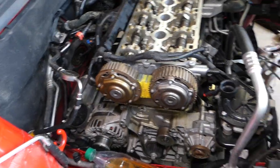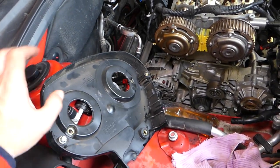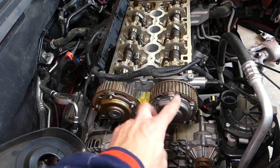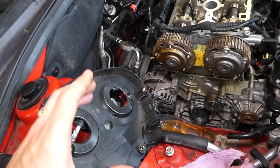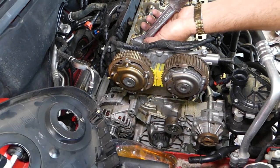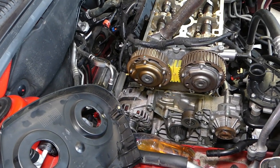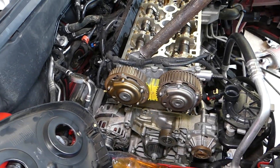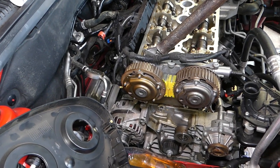Now, you don't want to make the mistake we did — we forgot to place the cover behind the camshaft gears. As a result, we now have to take everything apart and buy two new bolts, which costs quite a bit of money. That cover only has four bolts, but do not forget it. So that's it — thank you for watching. Hopefully the video was helpful. Please hit that subscribe button, and see you next time.